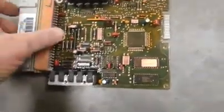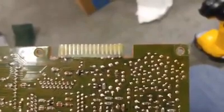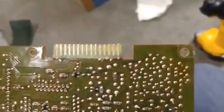Now for prepping the board. These pins — I've already wiped off the grease on this side, but on the back side you can see the original white grease. The lucky ones have white grease on them; if you're unlucky it's a rubbery conformal coating that's all over the board. If you have the conformal rubbery coating on this J3 port, you've got to scratch all that off with a fingernail or something and get rid of the rubbery coating entirely as step one.